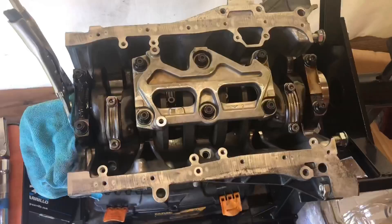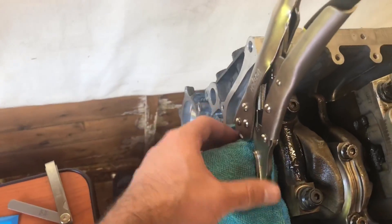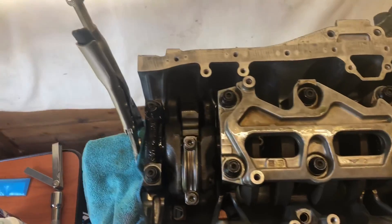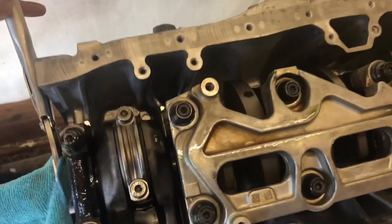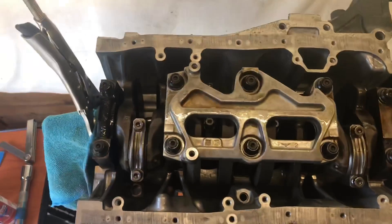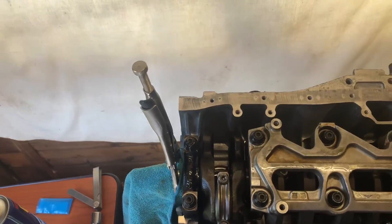As you can see all the pistons are installed now, all the rods - finally after waiting for the ring to be delivered. I've got a cover on there so there's no damage, it's only lightly on there. Apparently these ARP studs can warp the bearings, but I've checked the clearances and they're within spec. Also I've oiled the bores - look, it's moving so nice and freely. In my opinion from building engines, that is beautifully smooth. I'm not putting any effort in at all. Gonna get the oil pump on, get the oil seal on, and hopefully get the complete engine built today.